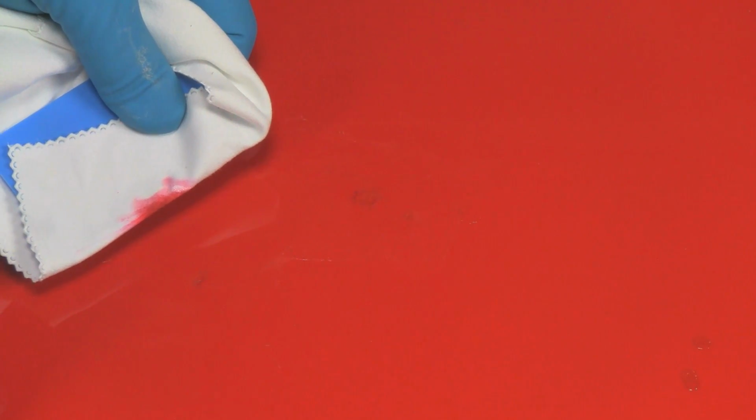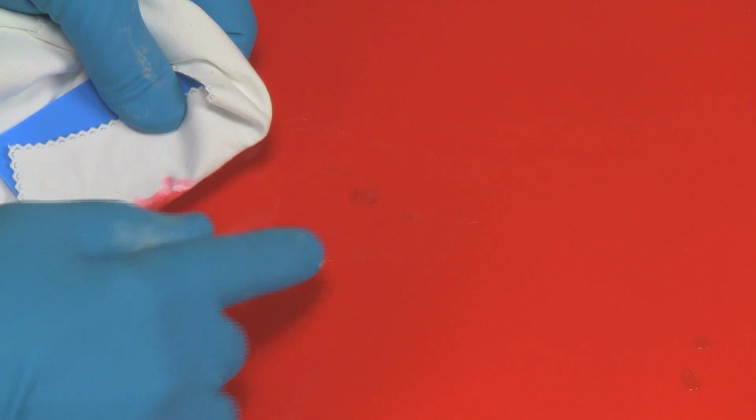It's okay to experiment. The one thing you don't want to do is let the paint cure too long, then it's very difficult to remove. You can't do much wrong here. If you find that you're pulling out too much paint, it hasn't cured enough, just stop, clean up what you've done, apply more paint, and wait longer.